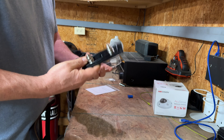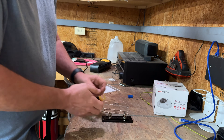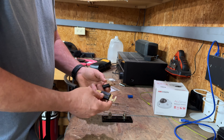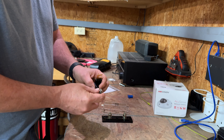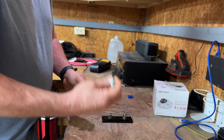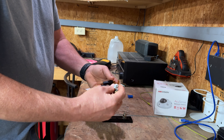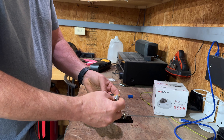The problem is I've only got one of these connectors left, and that'll also require me crimping a bunch of extra stuff on the ends. I've got the fuses but I don't want to go through the hassle of the fuse holders and all that. I don't see why I can't use a regular bolt and some washers and go right on the end of the fuse — put my wire on that, tighten it down, and this can clip onto the battery on the positive side, eliminating a lot of extra fittings and crimping.